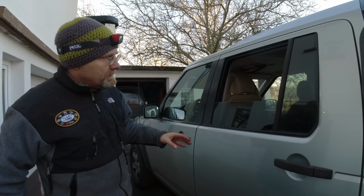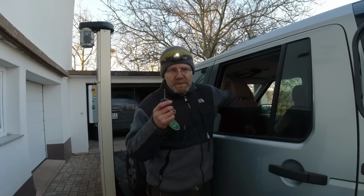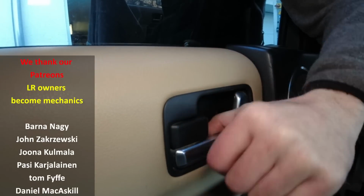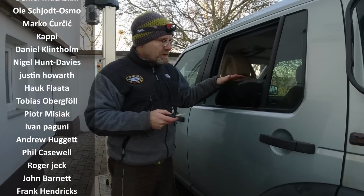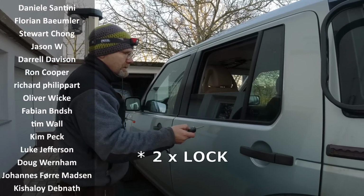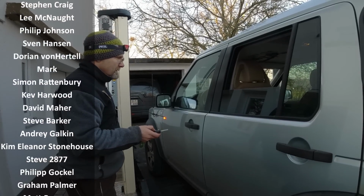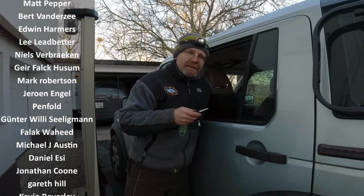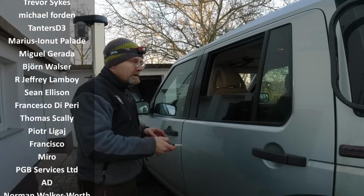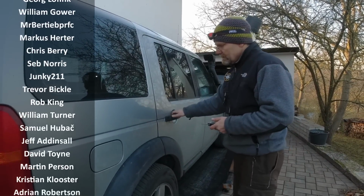Okay? Now you would go here, smash in that window because you can't open it here. And now you would want to reach in and open it, and that doesn't work. When you use the remote, it latches the inside opening handle. So when you lock your car, even smashing in a window will not release the handles on a Discovery. I think this is really awesome. If I hit it now twice, now I can reach in and actually flip that little switch and the car will open. Makes sense that the alarm goes on. When I hit it only once, the interior handles and the little release latch is disabled. I can't open it. So you can actually almost lock someone in on the inside. Double locking it has a different function than single locking it. So I unlock, it works, lock it, works. Good.